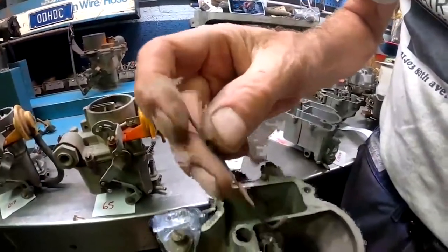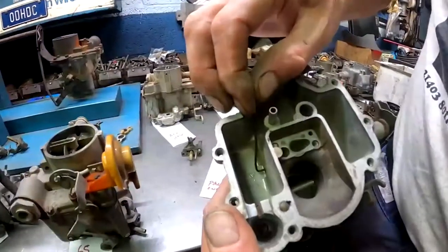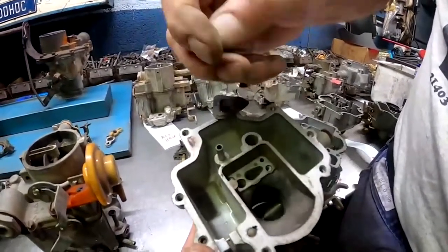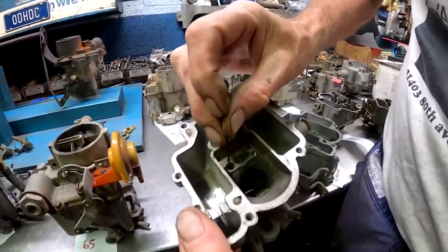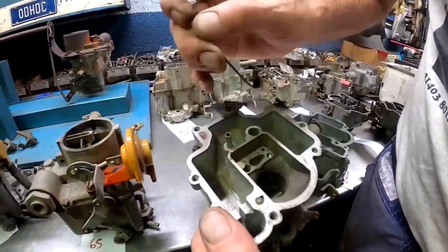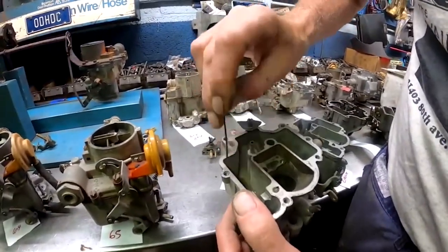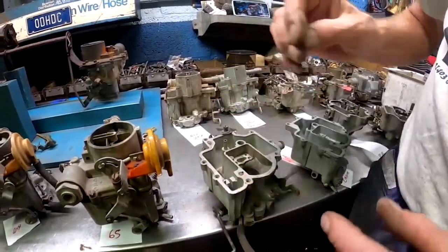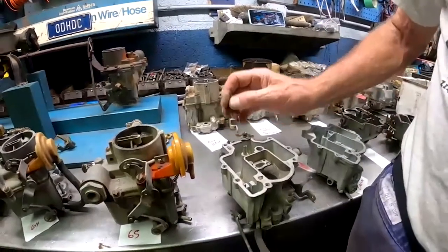the carburetor to a hole in the side of the carburetor, which intersects with the bottom of where our needle valve is at. Okay, so when our needle valve lifts off, it draws fuel directly from the carburetor bowl up into here and enriches the mixture only when you've got high velocity of airflow going through the carburetor.